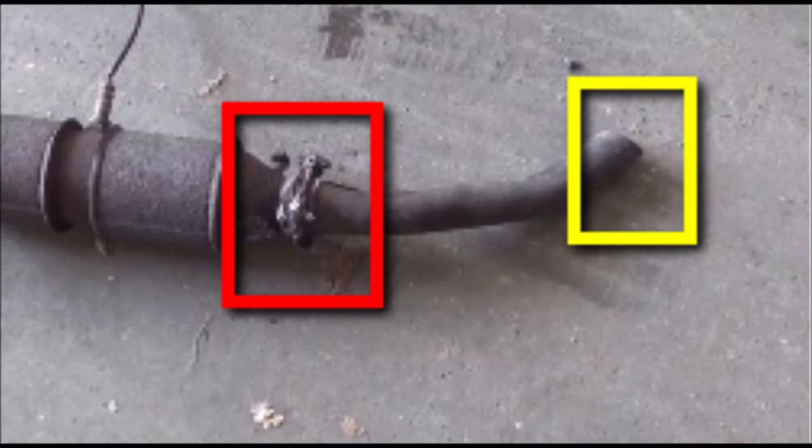And let's say you cut them out with a torch. So okay, I'm going to put 3 new bolts on there. You'll find out that once you get a new gasket, which you will have to do, and put those 3 bolts on, that there may still be a gap where they mate. Why? Because the facing has rusted off and became a part of the gasket to plug the holes, and you're going to end up getting rid of that when you take it apart.